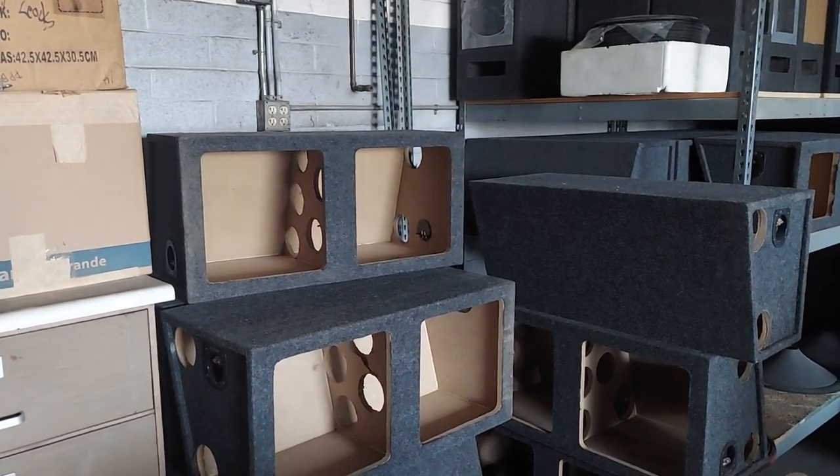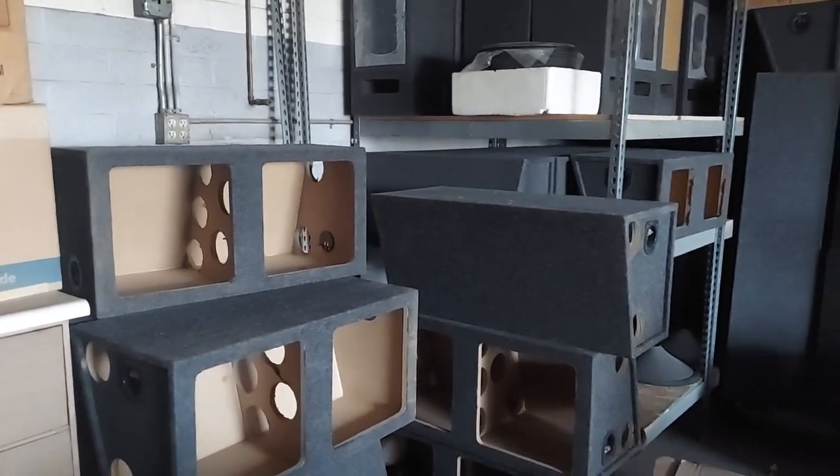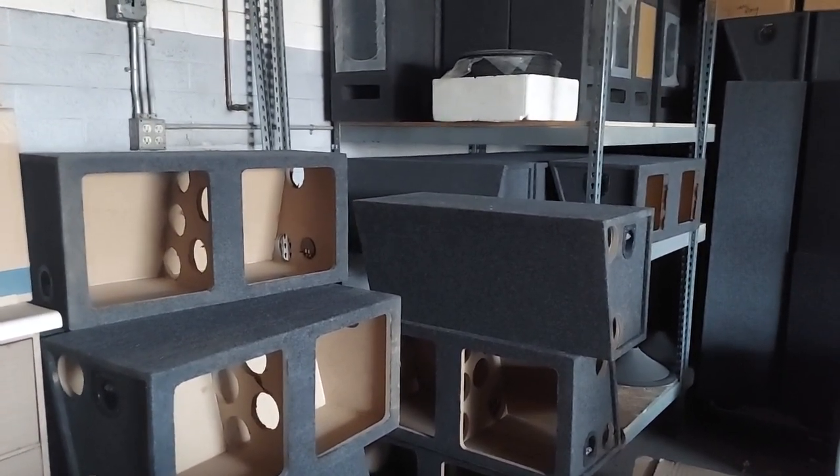I was training Chrissy today on the magnetizer — that was fun. I got a bunch of these boxes from the Onyx Audio closeouts. I had Ben drill these out and we put PVC down them, doing them as a single 15. They ended up being about 3.1 to 3.2 cubic feet, perfect for most 15s. We got these indirectly through Nathan from Sonic Electronics.